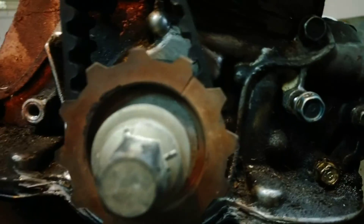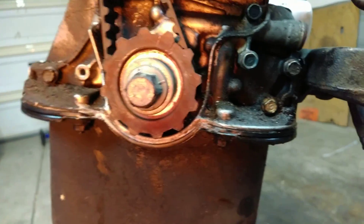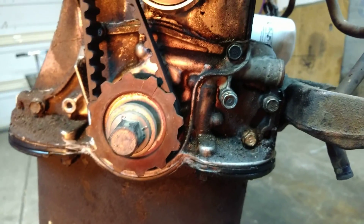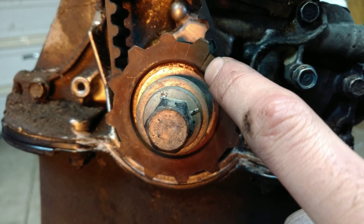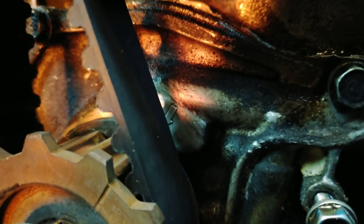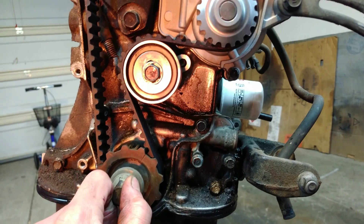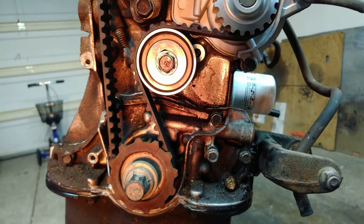At the bottom end, this is a crank gear from a D16Y8. This is actually going into an OBD2 car, so I need a crank position sensor, so I need to figure that out. But it's the same thing on a D15B7 crank gear — that line lines up with that arrow on the oil pump. As well as the crank pulley will have a couple lines that will line up on the lower timing cover, so you can double check.